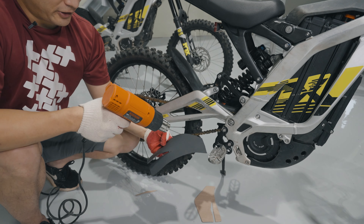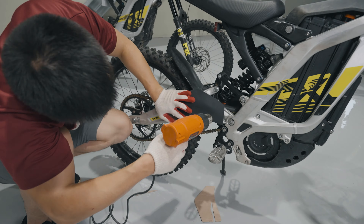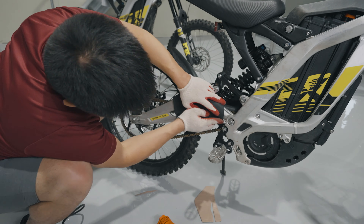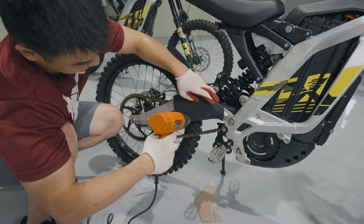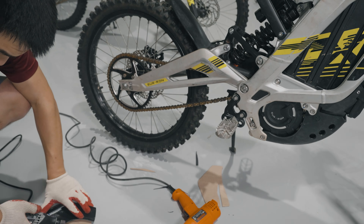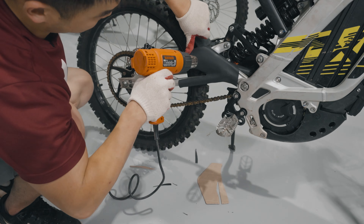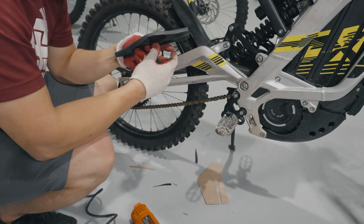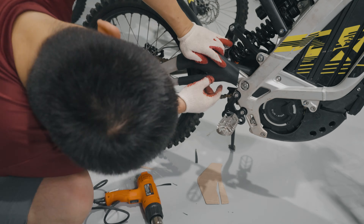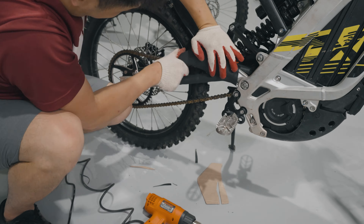The material is starting to bend, which is a good sign. Make sure to take your time with this — it takes a lot of patience. Work one area at a time; it might get frustrating but just do it one section at a time and it will turn out fine. As the kydex starts to take shape, cut off any excess material to get a clean fit.